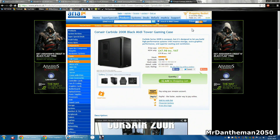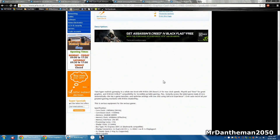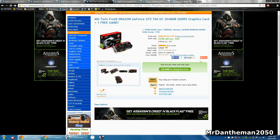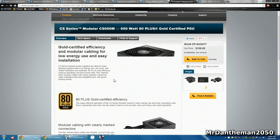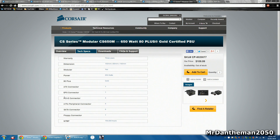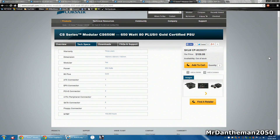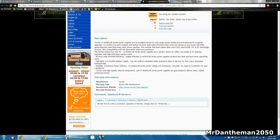Let's go back and have a look at the connectors to make sure it's compatible with the graphics card. As you can see, the graphics card needs one 8-pin and one 6-pin. Let's visit Corsair's website to check the specs — it says it has four PCI Express connectors. I do believe it has four 8-pin connectors split off to six-plus-two, so yes, it does support the required connectors for this graphics card.